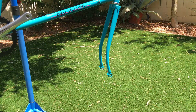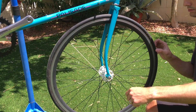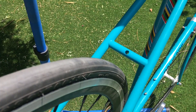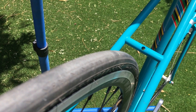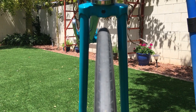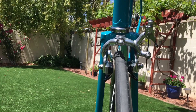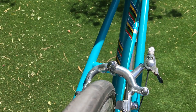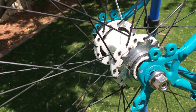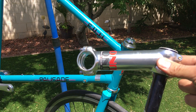For the wheelset, I bought these back around 2010 from Pure Fix Cycles — they claimed it was their premium wheelset, but they seem like an average unknown rim with what looks like Novatec hubs. No complaints though, they're just fine. This bike originally came with 27 inch wheels but converting to 700c works great. I checked tire clearance with my vintage brake calipers and there's still so much room — I only had 23c tires on hand but I'll definitely be putting bigger tires on in the near future.